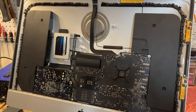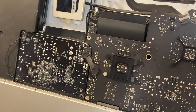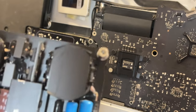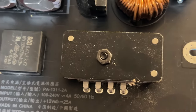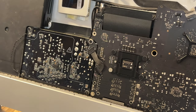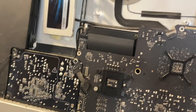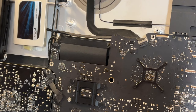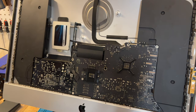We got the new power supply in there. As I said, it looks just like the one we took out — same brand, made in China. We're going to plug it in and see if we get a boot chime. The fan's not plugged in, but everything else is hooked up. We don't need a monitor for this thing to boot up, so it should boot just fine if that is the issue. I'm really hoping it is — we'll find out in a moment.